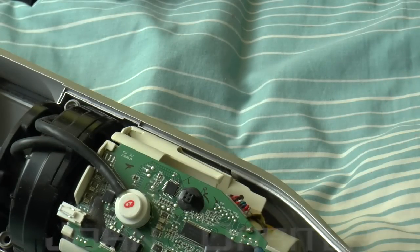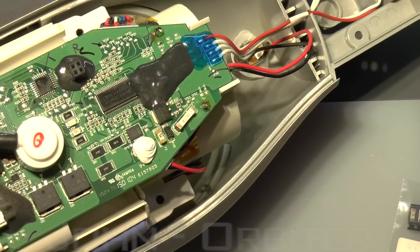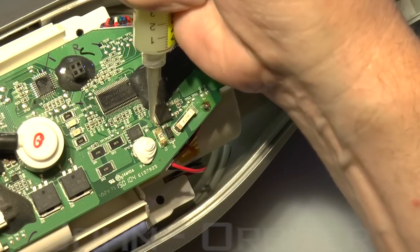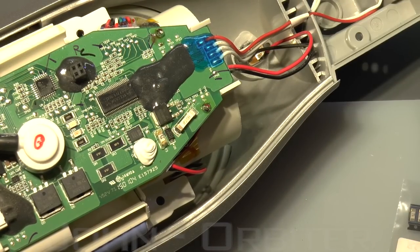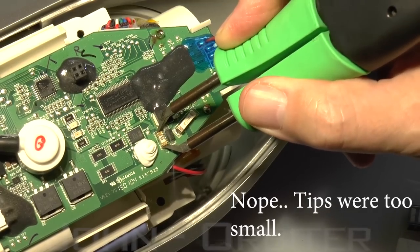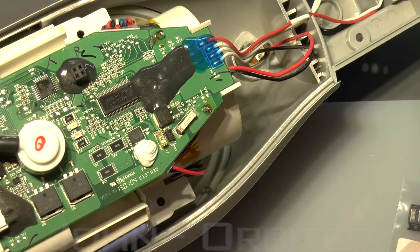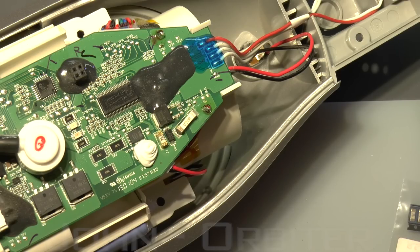To carry out the actual task, I've moved over to the bench. I'm going to get a bit of flux first and just put a bit on this old blown fuse to help transfer the heat down to the pads. Then I'm going to get these tweezers and see if I can get enough heat through this fuse to take it off. The tips are really small on these tweezers — I'm not actually sure if they'll work. It's going to need the bigger tips, I think.